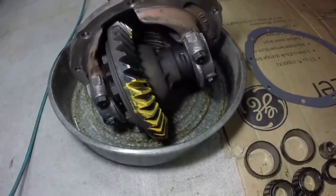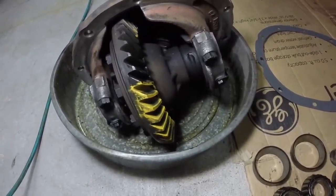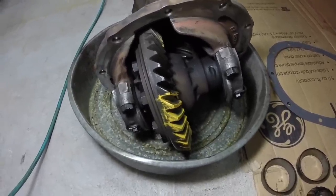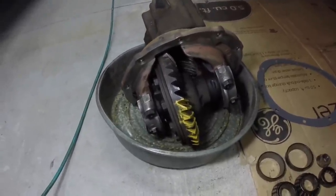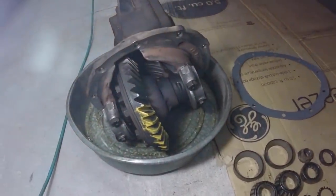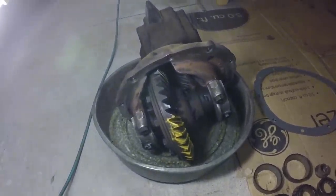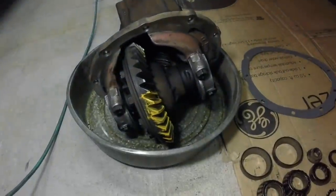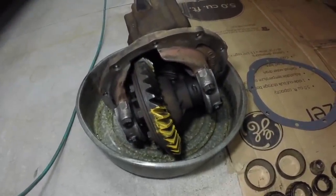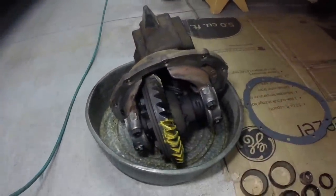You always want to make sure you know what you're doing when you work on differentials so you don't mess them up. If you've got a leaking pinion seal, you can change it without pulling the carrier. You've got to have an inch-pound torque wrench to see what the preload is on your bearings, and then re-torque that nut to what the preload was, and tighten it another 7 or 8 inch pounds — and that's it. You don't hammer on your yoke at all. I see people on YouTube beat the yokes back on and then just reef them down — that diff's life has just been shortened.